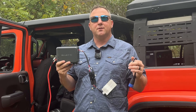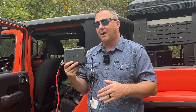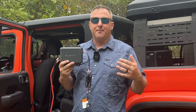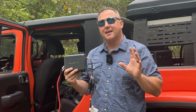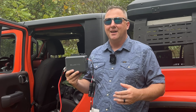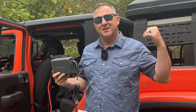What do I think overall about the Bluetti Charger 1? The concerns I mentioned at the beginning are brand-agnostic — whether you get the Bluetti, EcoFlow, Picron, or any alternator charger, they carry similar risks. But this thing works perfectly in the sense that any time the vehicle is running, I'm putting 500 watts of power back into my battery bank. Within an hour I'm putting 500 watt hours back in, and within a couple of hours of driving long distance, I can recharge these massive batteries completely.